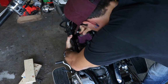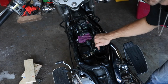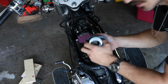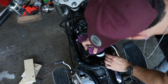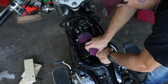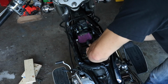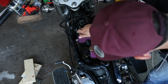Once again, the PVC pipe is just so that these boots, when they tighten up, they aren't just tightening up to another piece of rubber. They're tightening up to somewhat solid, and you can really crank on her, and be pretty confident in your air seal, and that these things aren't going to pop out on you. Look at that. Pretty sweet.